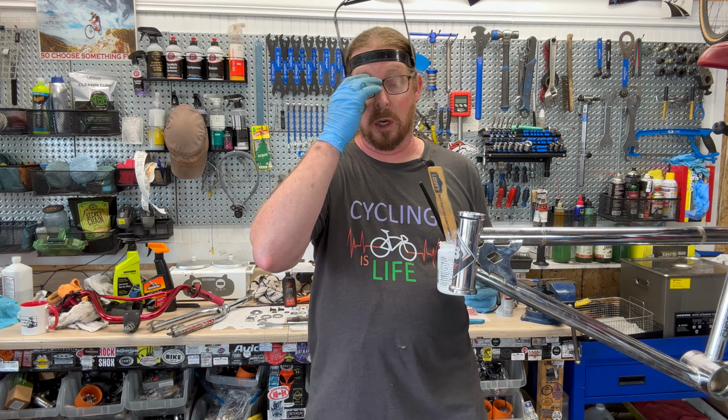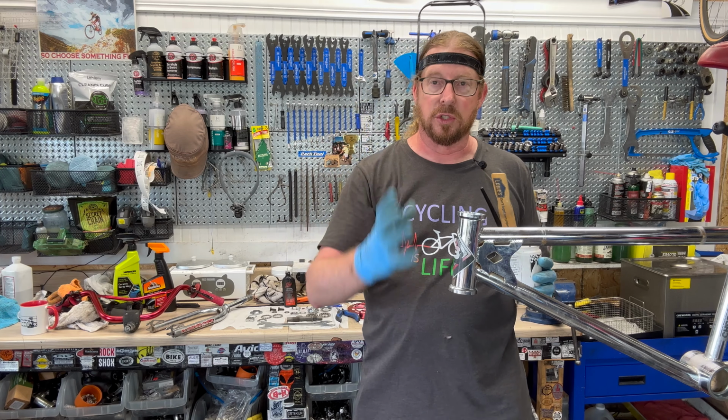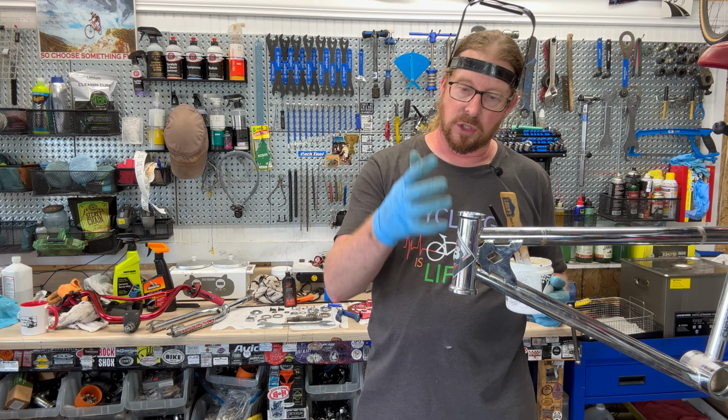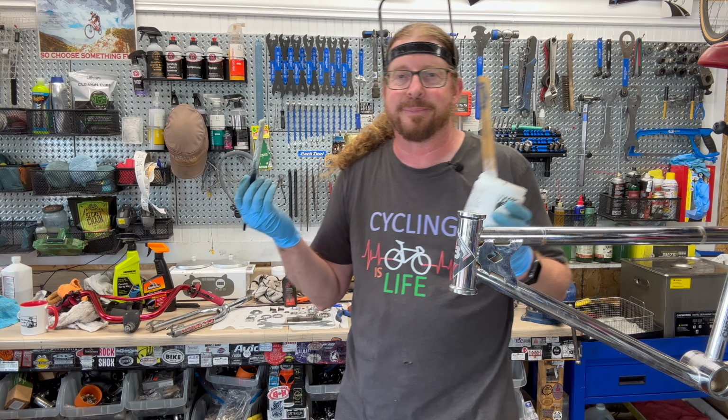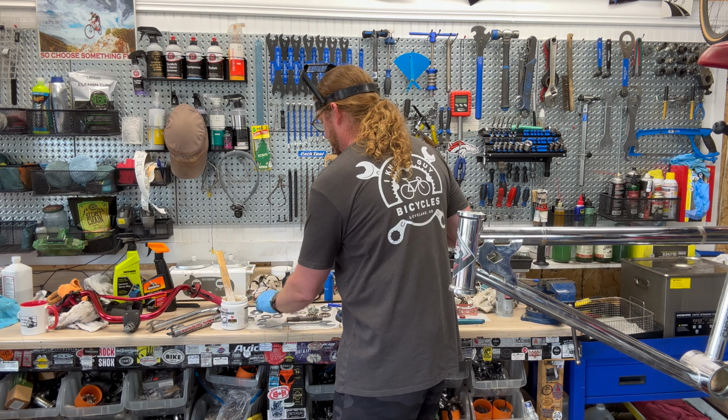So we're going to put the fork back together, threaded, and then put the handlebars and stem on so I can do the detailing in the next video. But I want to show how this all works. First, you want to get a good layer of bearing grease. There's a lot of different greases out there. You want to make sure it's a bearing grease. You can use Phil Wood, or you can do the fancy Shimano stuff. This is Finish Line bearing grease, which I like because it's a whiter color. It used to be white, if I'm remembering correctly, but it's kind of discolored over the years.